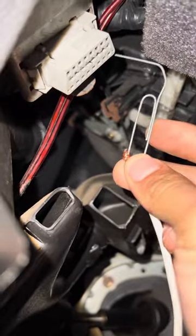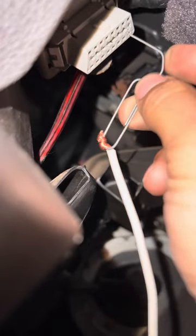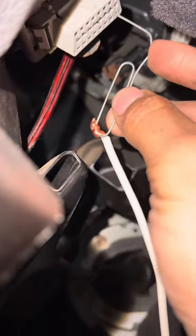Get down here and look for pin hole number one — this one should be right here. Be gentle with it, you don't want to break that. Gets in there. Make sure it's stripped on the other side and find a ground. I'm using this hole in the firewall right here, bent it a little so it hugs it like that.